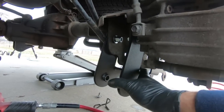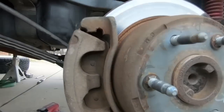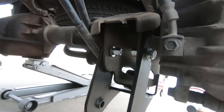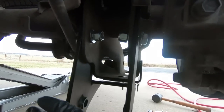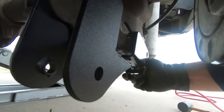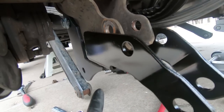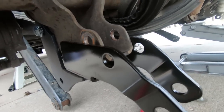So I got this other side on, and I went to put the shock extension in place, which is our next step, and I noticed that it's going to have to go underneath of this. So I had to loosen. What I did was I left these bolts in place. I just loosened them up. I took the bottom one out that comes into this relocation bracket, and then we can sneak in the Beltec, which I'll list in the description as well. But probably if I would have bought DJM shock extensions, this wouldn't be an issue, but maybe it would. I'm not really sure. So it's not a big deal.